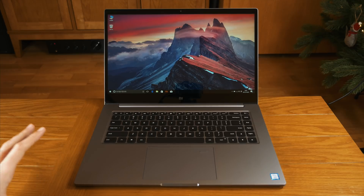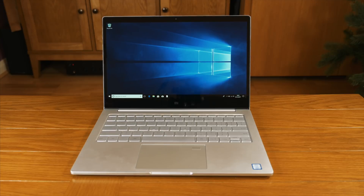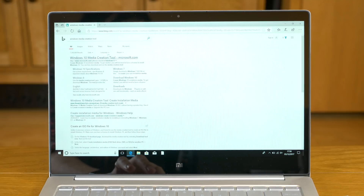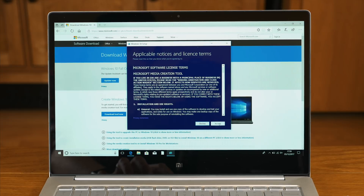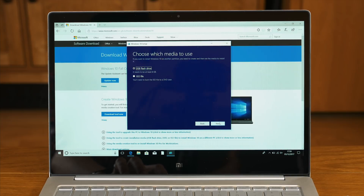We're now running full Windows 10 in Chinese, and what we want to do is now switch to our other Windows machine to get the media creation tool set up. For the next stage you'll need another Windows laptop — in this case I'm going to use my Xiaomi Air. You'll need a spare USB stick; make sure there's nothing on it because it will get wiped. Navigate to the Windows 10 media creation tool, click Download Tool Now, and once it downloads click Run. Click Yes and Accept until it asks you what you want to do, because you want to create installation media. Keep clicking Next and Accept until it asks which media to use, then choose to create a USB flash drive. It can take anywhere up to an hour to create the media, so just leave it running.